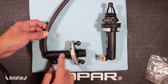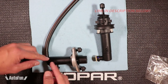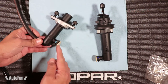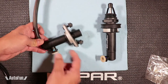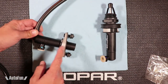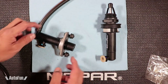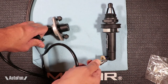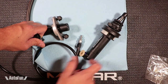These are the brand new parts I'm going to be installing — the master cylinder and the slave cylinder — and they are fully dry. If you buy the master cylinder as a Dodge brand new OEM part, it will come with the reservoir already attached, and it's also going to come with the line that goes to the slave cylinder pre-attached. Also, the slave cylinder is going to be pre-filled with fluid, so a lot of the work has been taken out already. So in a way, it's partially already bled — the only thing you'll have to do is connect the other end of the line to the slave cylinder and follow the factory procedure.